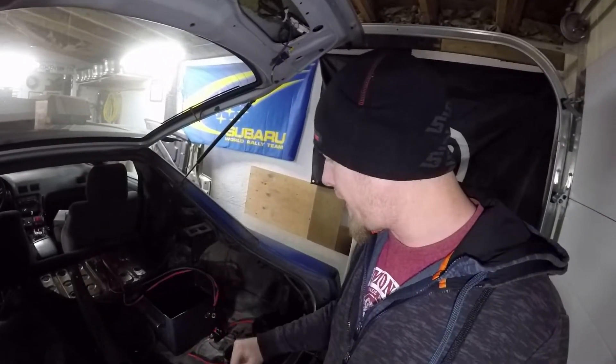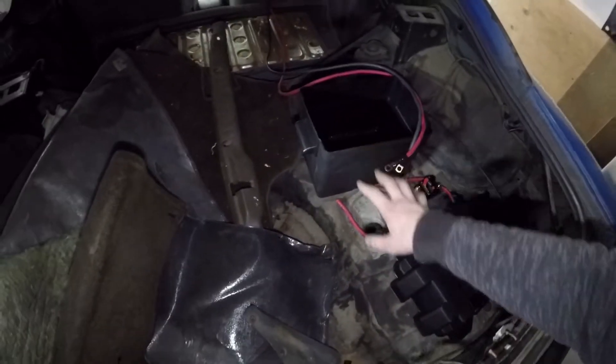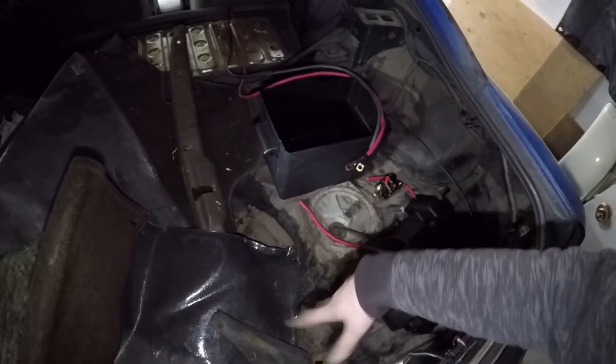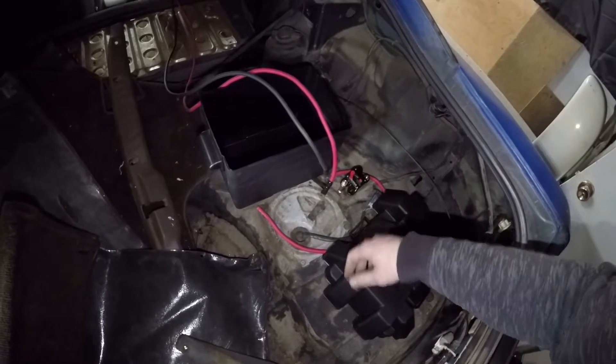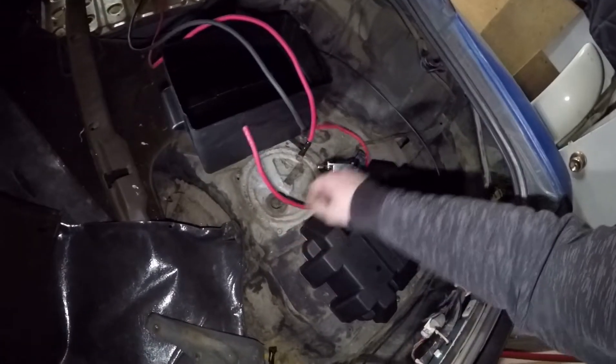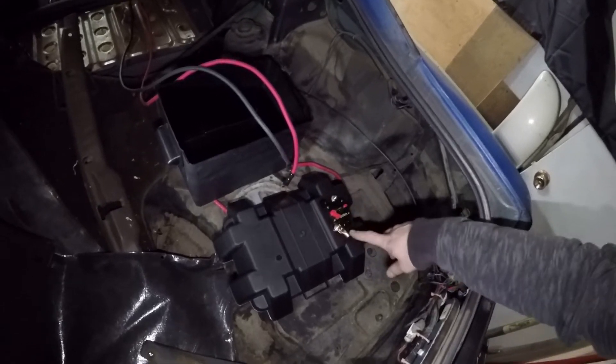What I really want to do is just get the battery box bolted in place on the body of the car. I'll probably just drape the cables inside of it. I may put terminals on the end of them for now, but I don't have a battery yet so I can always leave that for the end. This is the location of the battery box I've chosen - I've got the two holes drilled down through there with bolts temporarily sitting, because I literally need to get the carpet and everything else installed and cleaned up anyway. I've got the two new terminals already soldered on the end of the cables, and I'll just need to do up a little length of red cable so I can get the breaker installed. I'm going to install the breaker on top of the lid and then run the second wire down in.